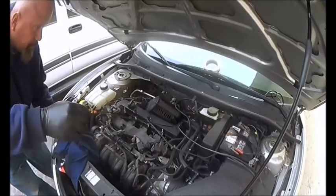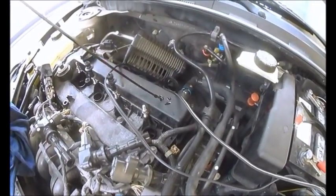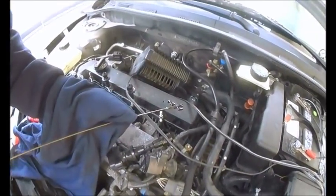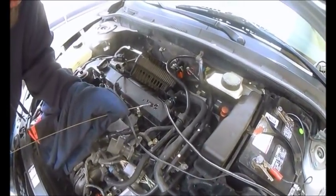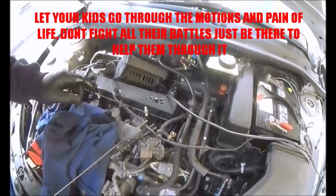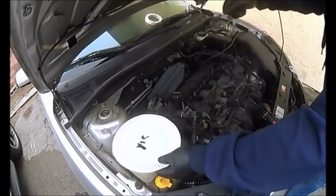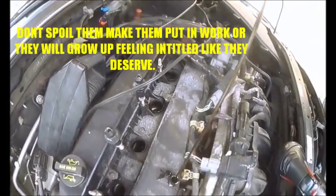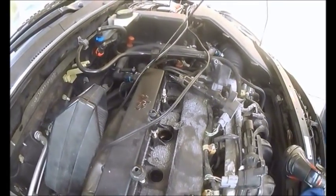Let me drop some drops here on the surface. Look at the color of that oil — that color tells me there's water in it because of the look of it. If you look at other oil, the oil is not that color; it doesn't have that light look. But if you put it on a dark spot, you can see how it's a little tan. That tells me there's water in there.